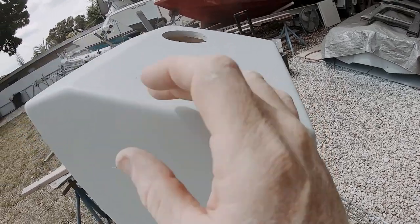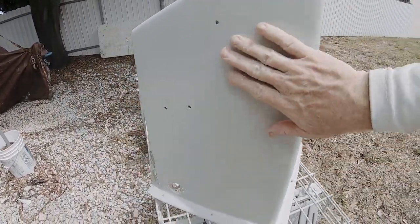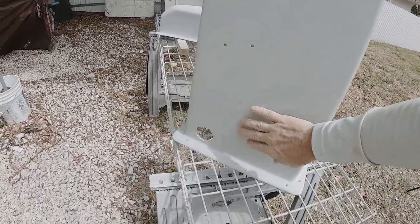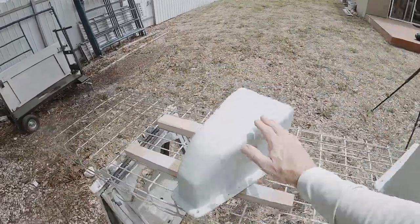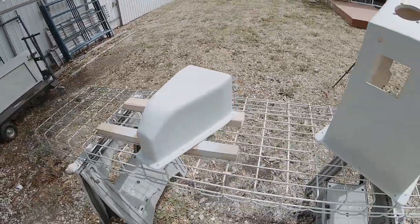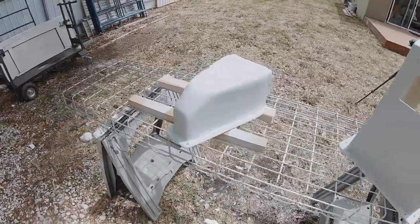I think I have a little water in my compressor line - I need to get a better filter. There's going to be a binnacle mount here so all this is going to get covered. All in all it came out pretty good, so I'm just going to let this dry a little bit more - it's in the direct sunlight. I'll wet sand it, probably with 220 to start, and then shoot another coat of primer on it.